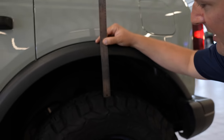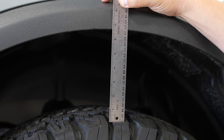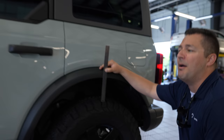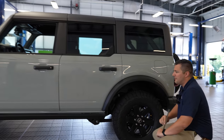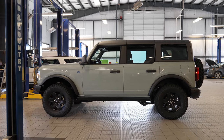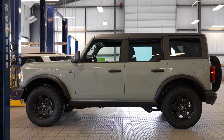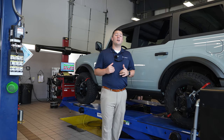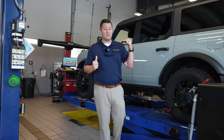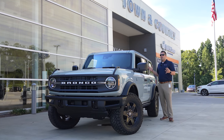Let's check the rear and see what we've got going on here. It looks like it's almost dead-on — very very close to level, if not a little bit more than level. I actually would not have noticed that unless I had measured it, because just sitting back and looking at it, that thing looks absolutely perfectly level and it creates the perfect amount of tire clearance. Although this leveling kit is easy enough you could probably do it in your driveway, you want to make sure you get a professional alignment done on the vehicle afterwards, otherwise you're going to be tearing up a whole lot of stuff — and your tires is just one of them.